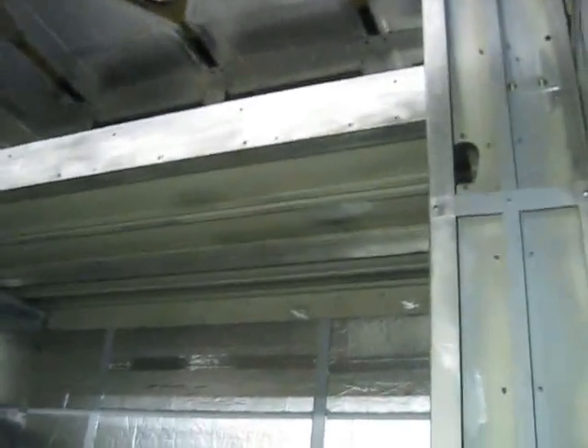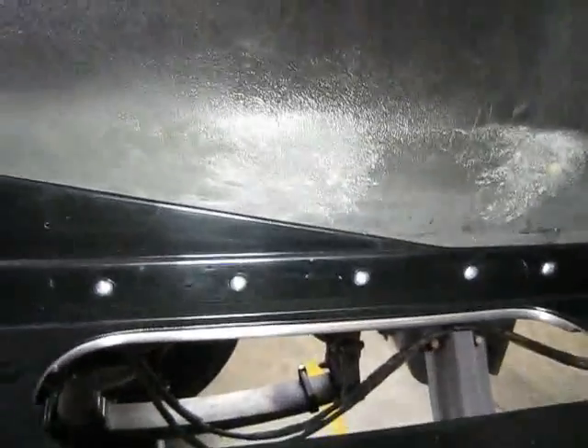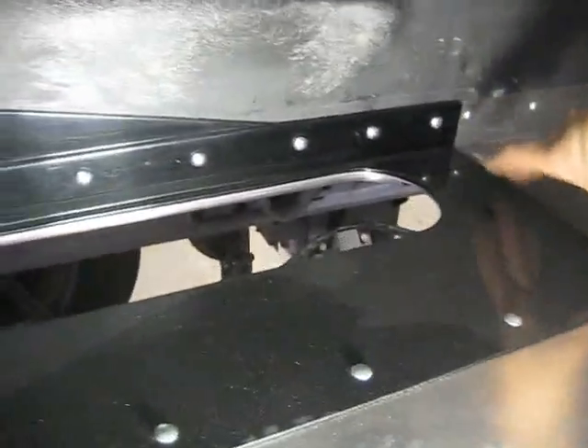So a typical Aerodyne interior, 108-inch cab, upper bunk, etc. The one huge improvement I made here is this steel section that catches the front panel to the tunnel to the floor — it normally finishes here, just a little short piece. So I added to it a huge eight-inch piece all the way, so it captures the entire shifter opening and all these rivets capture right into the floor underneath. Certainly a lot stronger than it originally was.